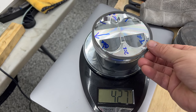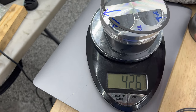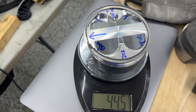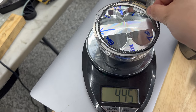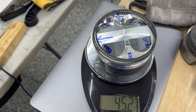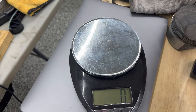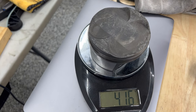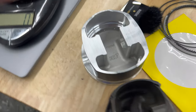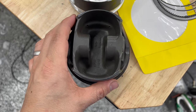Here we go. This is the steel ring, this is the second compression ring. It was 426, so 10 grams difference. No, I'm not going to put these rings on because the other rings are wrong. I suppose I could put those two on - 445. There's the expander - two grams for that. And then the two scraper rings: 452-453-ish. And that one together was again 416 grams. So not that bad of a difference considering that you're going to a 4-liter. The wrist pin area is a little wider here - not sure what that's all about. Engineers watching this, let me know your thoughts.